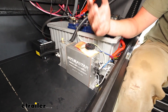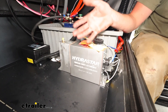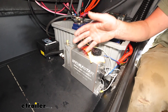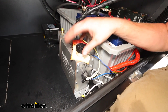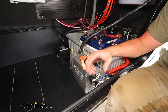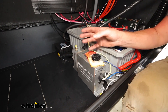The actuator is not going to be the hardest part of the install. You're still going to have to put on the disc brakes to convert those over for this to even work. With the 1,200 PSI that would be a drum brake conversion. With this we are running disc brakes, and we're going to be tying into an existing seven-way. The truck already has a brake controller, so you'll need to have that seven-way, the brake controller, and switch over to disc brakes if you're moving to the 1,600 PSI version. We'll walk through the whole install, and you can check out the other videos if you want to see how to do the disc brakes and line run.